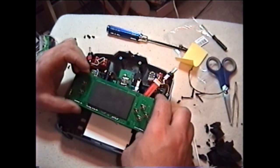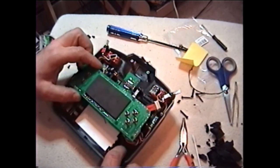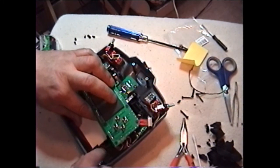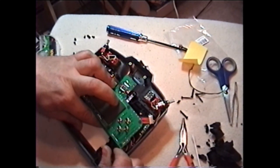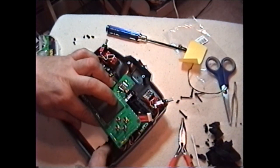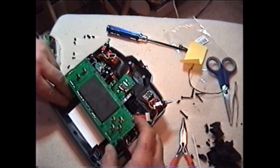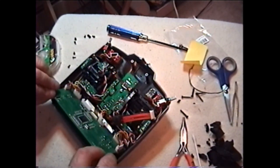Make sure the LCD and the new LED control board are all laying flat. All four buttons — they put the wires coming out of the side of their little LED block here — just make sure you're not blocking where the pin has to go. Here it looks like the black one is in the wrong position. Remember to put any buttons that fall out back in, and gently spin this back into place.